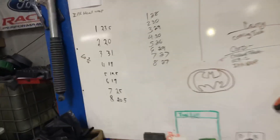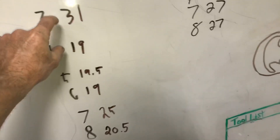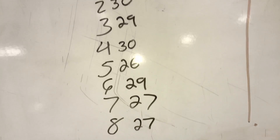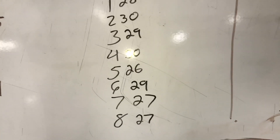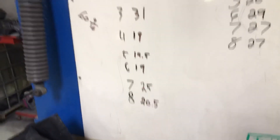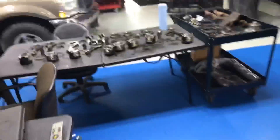We might possibly check these for length. When that protrusion is that far off — that's nuts, I've never seen one that far off. It's ranging about 12 thousandths, which normally they're not that far off. Look at this other engine right here — nothing concerning at all — four thousandths difference between all of them. That one is 12 thousandths, which is very concerning.